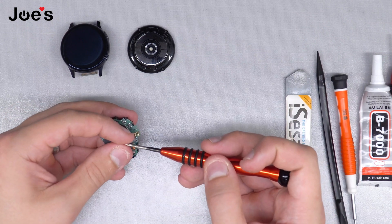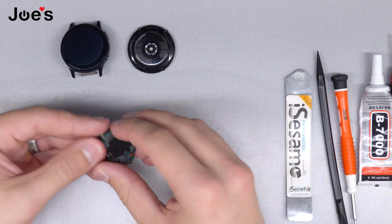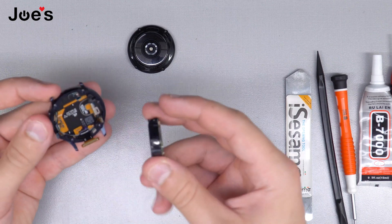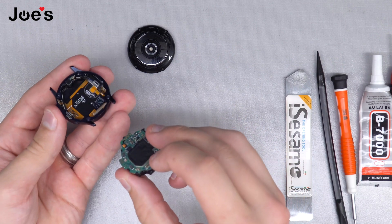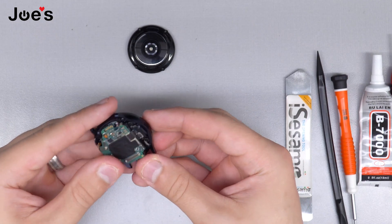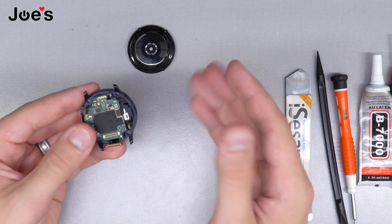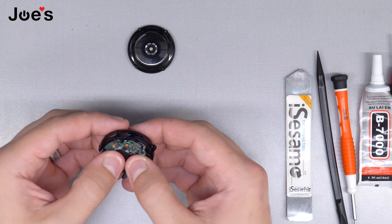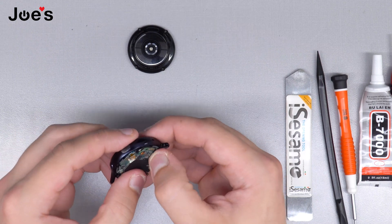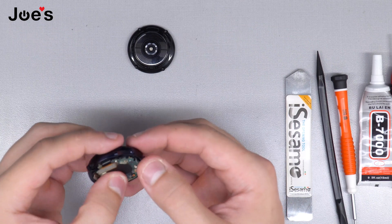Put the board back on, then take the Phillips screwdriver and screw the screw in. Now this part's a little tricky — you've got to make sure all the connectors are spread apart. The bigger connectors go to the screen, so I like to put that on first. Make sure all five ribbons are out of place — do not fold them in — and go ahead and press down. You'll hear a couple of clicks. All the ribbons should pop in freely without one being too tight or too loose.